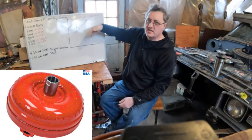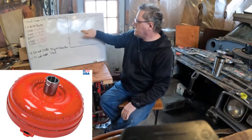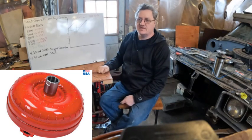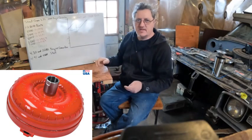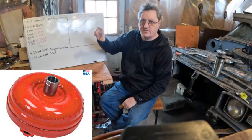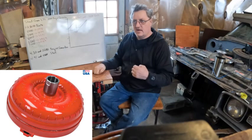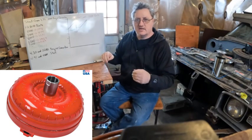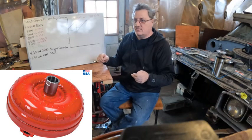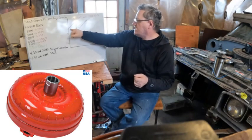The RPM remains flat for a while at around 4000 until it locks and is going fast enough to work properly. The area between these lines forms a triangle, and that area represents slippage. If your stall speed is close to the RPM drop it won't be too bad, but when there's a big difference — like 4000 versus 3274 — that's enough to cause significant slippage. The purpose of the torque converter is to allow slippage at the start line so you can launch harder, maybe shaving off half a second, but you could be giving back half a second here in addition to generating a lot of heat.